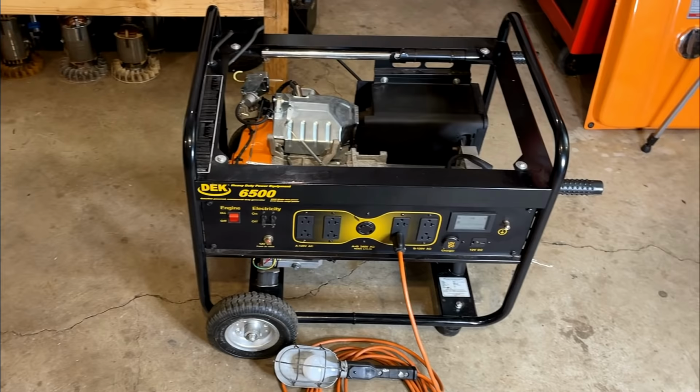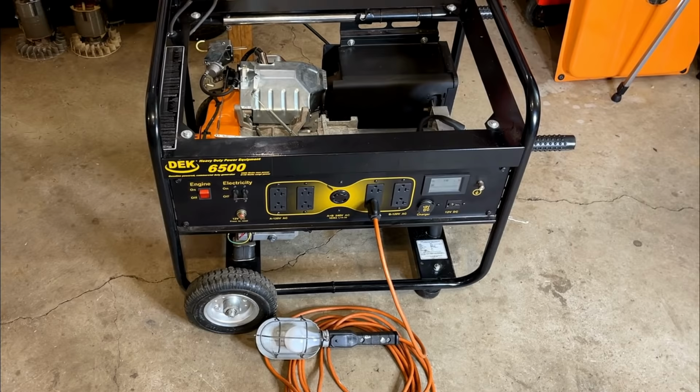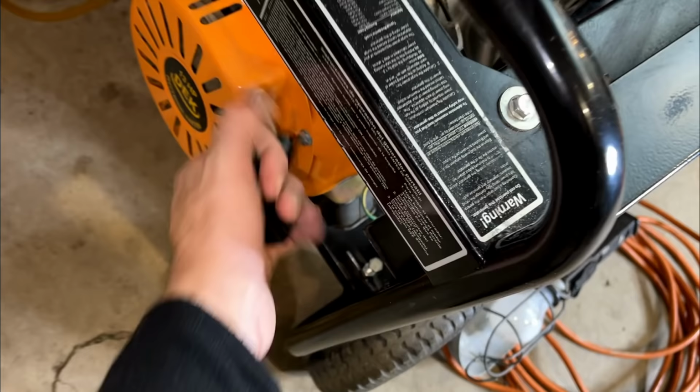Really, the only two things left I can think of are both valve related. And being that I replaced a broken valve, I think that is most likely the cause here. So I would say either the compression release is overly aggressive and it's letting out too much compression, or potentially the leak down is really bad. But I don't think that's the case, because when I pull the engine over, I mean, I could hook up the leak down tester and find out for sure.